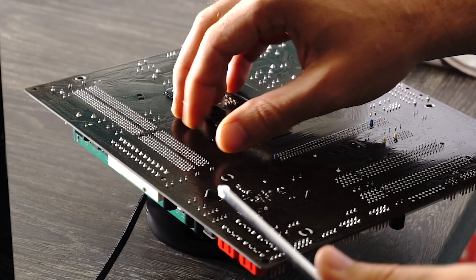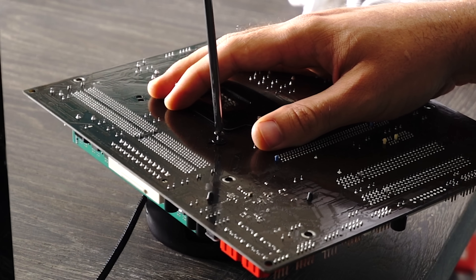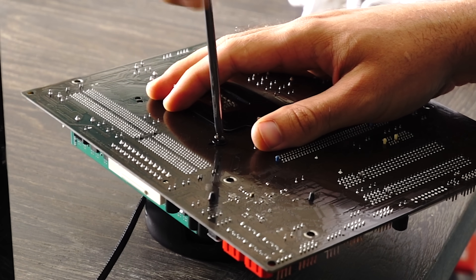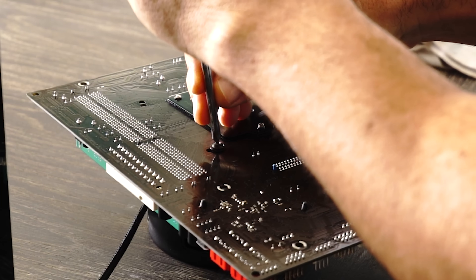In the case of the motherboard I had — an ASRock H55 — you could only mount it on the diagonal because it didn't line up perfectly. However, diagonally mounting a cooler is still better than not mounting it properly at all. You'll still get a really good connection. In the case of this Intel cooler, it only weighs 180 grams, so it doesn't have a lot of cooling potential.